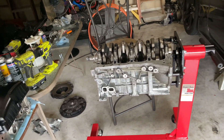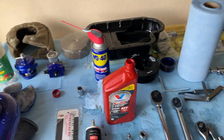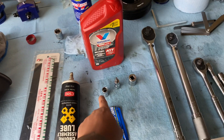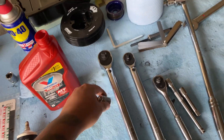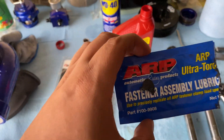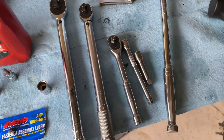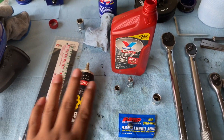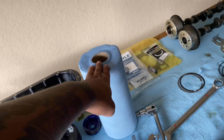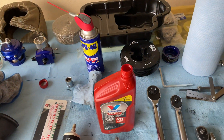The first step is putting in the crankshaft and figuring out your bearing clearances. You're going to need a plastigauge or mics if you have access to them, assembly lube, an 11mm 12-point socket for the rod bolts, a 5/8 12-point for the main caps, ARP assembly lubrication, automatic transmission fluid, and shop rags. The reason you use ATF and shop towels is to keep your engine surfaces as clean as possible — it's a pretty good cleaning solution.